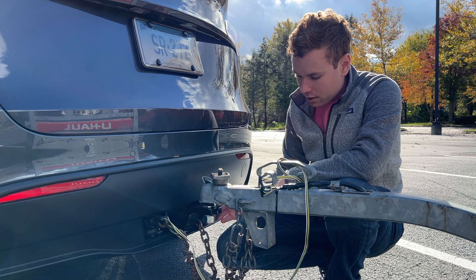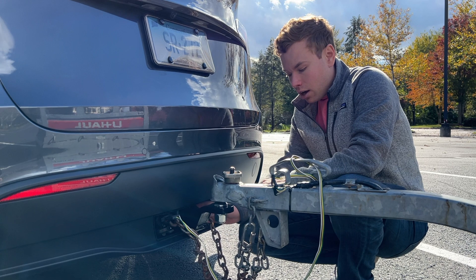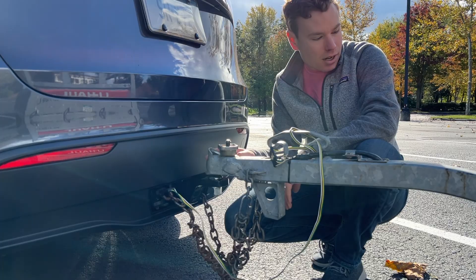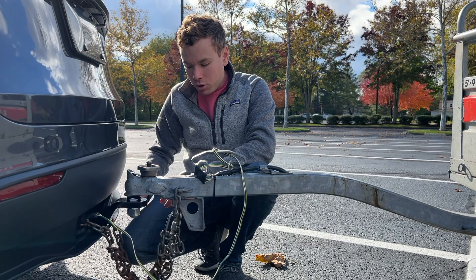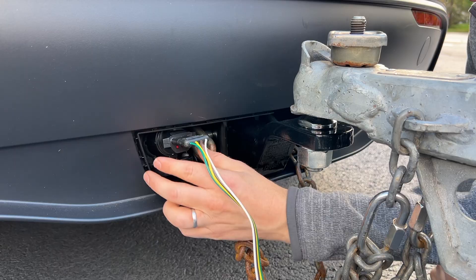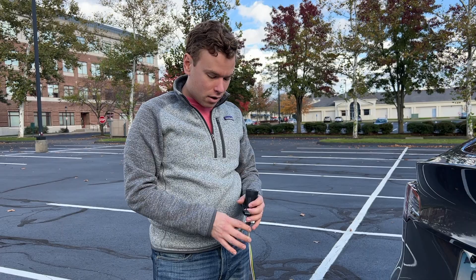The key thing is it's a three-quarter inch rise — you want the trailer sitting nice and level, and this is the appropriate ride height. Once you have the hitch adapter assembled with the ball, you slide it into the receiver. Then we use a 5/8-inch pin with a cotter pin so it can't come out. Once the hitch adapter is in and locked with the pin, you're ready for the next step.